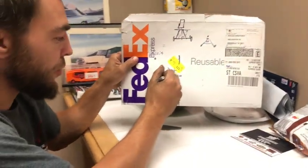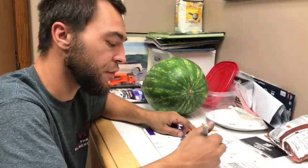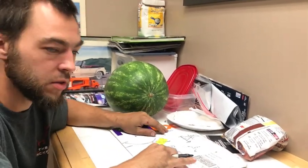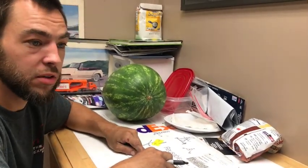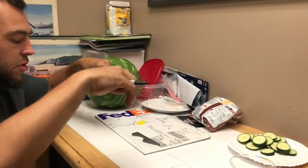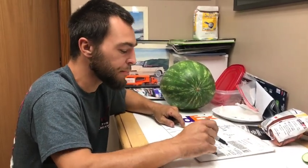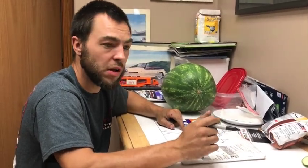There's also a setup called a watts link. Watts links are more used for off-road purposes where you have two attachment points on the chassis and a pivot point on the rear end. A watts link in simplicity has a pivot point on the center of the rear end, so when it goes in motion it acts like a bike — it's a little more complex, works great, but it's heavy and bulky and not needed.